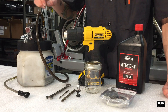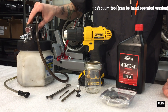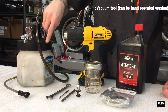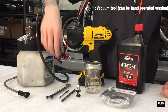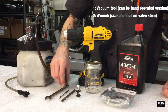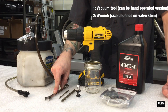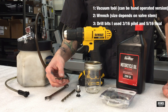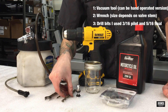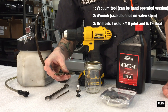Going down the line on some of the tools we're going to need. This is a MightyVac — it's a vacuum-operated brake bleeder that hooks up to an airline. You just need a wrench; the size depends on what you need for the valve stem nut — this one's a 12 millimeter, sometimes you'll need a half-inch. We've got a pilot drill bit here, 3/16ths, and then a 5/16ths.